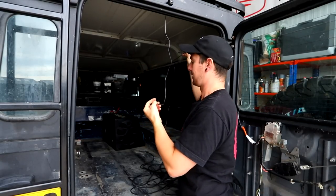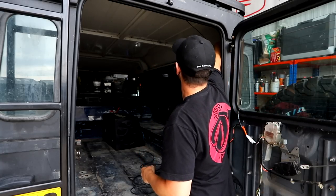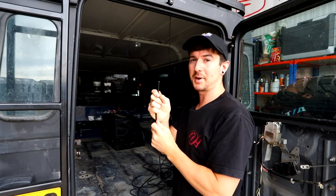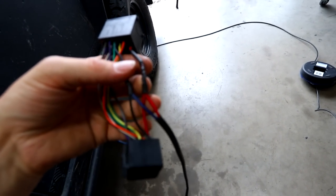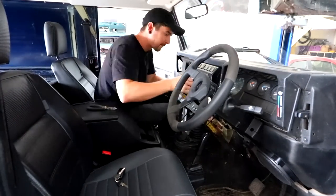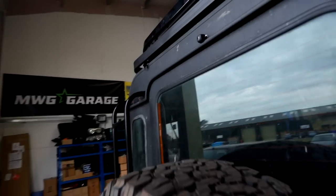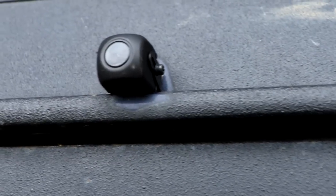Got my feed from the camera at the back of the head unit, got the camera there — connect them up, tuck them away. Then all I've got to do is take the other end of the power cable I just found and find accessory power from somewhere. This is the ISO harness for the head unit and I've just teed into the accessory power and the ground there, so if I plug this all in it should work. Got the head unit back in, and if we press the camera button we get a reverse camera — pretty happy with that!